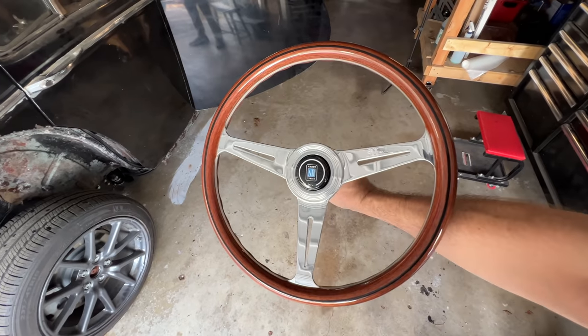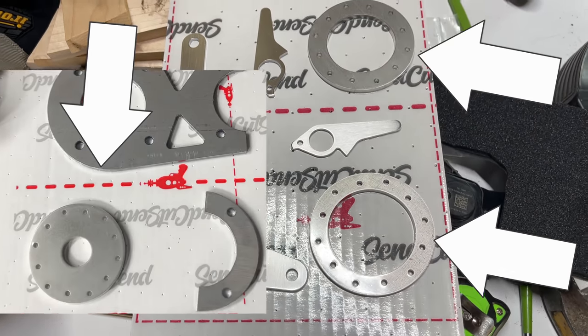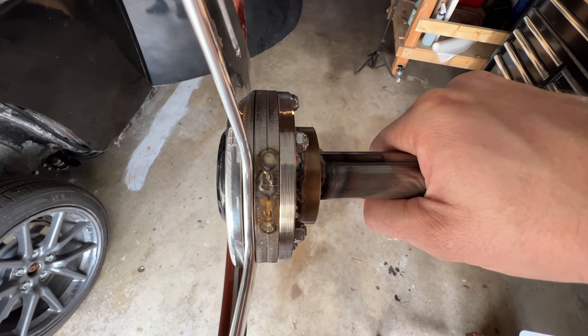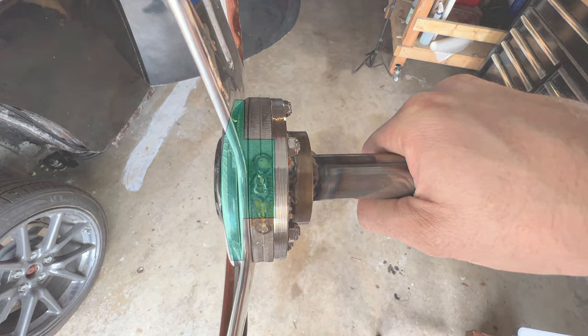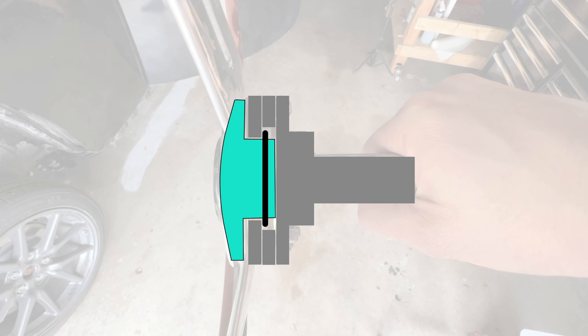On the other side of the steering is the wheel. I had a few flanges laser cut by SendCutSend. The horn button on the steering wheel sits back and is held in by a spring clip, so I made three flanges with different internal diameters. The first one centers the horn button assembly and has a ledge for the spring clip to hold onto. The second is a spacer to fit the back part of the horn assembly, and the back flange is what it all mounts to. The front two flanges are welded together and tapped, so the wheel bolts to those. The bolts extend out the back and are held on the back flange with lock nuts.